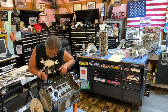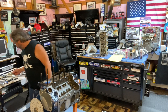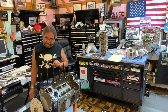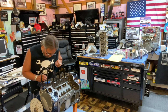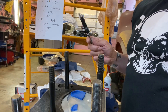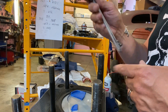We'll cut it down, measure it, and see what we've got. I'll cut the part where I think it's deepest — right across here. I have coated pistons and I try not to scratch them, but it doesn't matter at this point. One thing to know: if you use too much modeling clay and you have tight clearances, you're going to force it down into the gas ports or between the piston and cylinder wall. So take your time and don't use too much — just the right amount. Looking back at the exhaust: 94 thousandths with the dial indicator, 106 thousandths with clay and checking springs. Now let's check it with the actual springs.